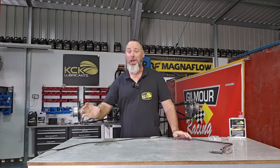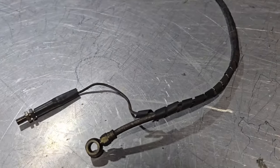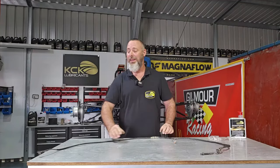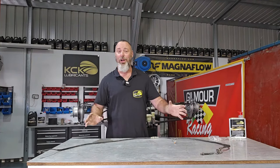I've figured out where all these brake lines go. This one here is an easy find because it's got the speed sensor on it that used to fit to the front left tire, and that's the plug that goes in through the center of the car. It's got a banjo bolt from the master cylinder and then a banjo bolt for each of the brake calipers, so this is actually quite straightforward.